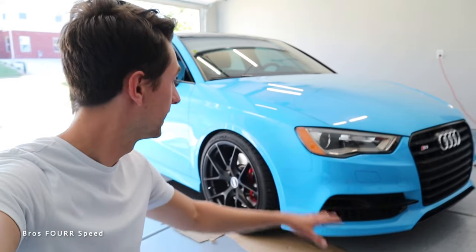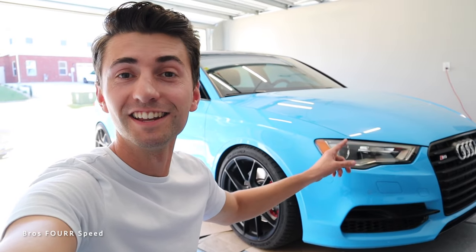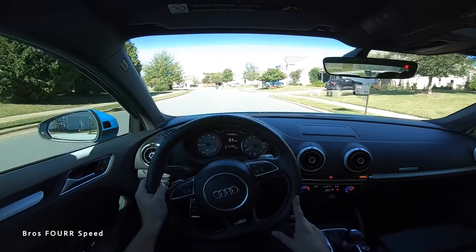I've now successfully adjusted the steering wheel. Those reference lines are nicely lined up. I've expanded this one full rotation to get the rotor aiming more to the left, and on the other side I shortened it to aim it more to the left as well. With the car back down on the ground, wheels torqued back to spec and everything nice and tight, it's time to drive the car and go back to POV.